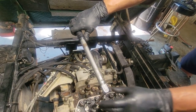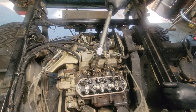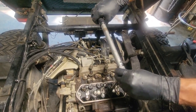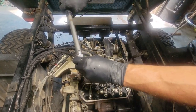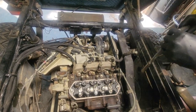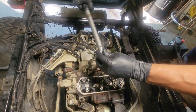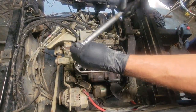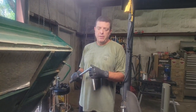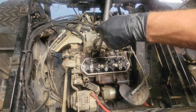Then I'll get over and cross them to the next one. Now I'm going to go to 25. From here we've got them torqued to 25 foot-pounds, then I'm going to go to 28 foot-pounds and we should be good to go — the 28 foot-pounds is just a sanity check.